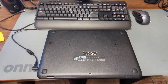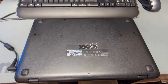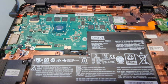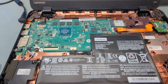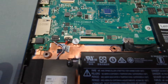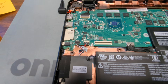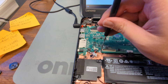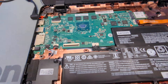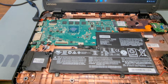The back of this Chromebook is pretty simple — just a handful of screws. Take those off and pop the back off. Once inside, you're looking for a screw, and most of the time it's under a sticker. On this specific model it's under the Lenovo sticker. Remove that screw and that will disable the write protect so you can install other things.